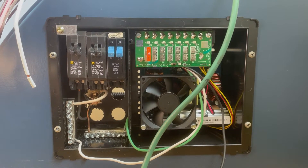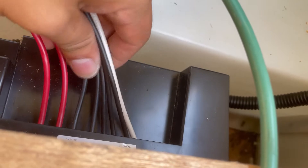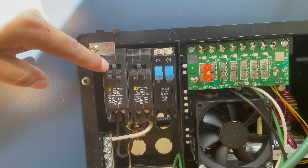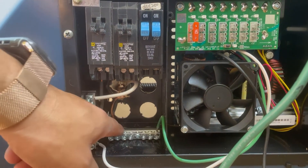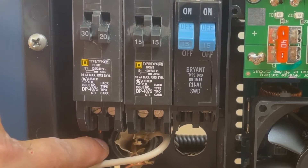I want to give you an idea of how I'm wiring the PD 4135. Behind the power center there are wires all in order — the first one is the battery hot, the last white one is the negative, and all the others power the lights and everything. On the other side, the first one is the power from the generator — the 30 amp — and then the others are additional branch circuits. The white wires go here, the ground wires go here, and the black wires all go up here. I'm going to add a ground wire to ground this whole bar.